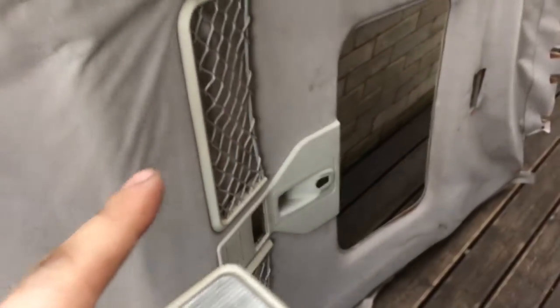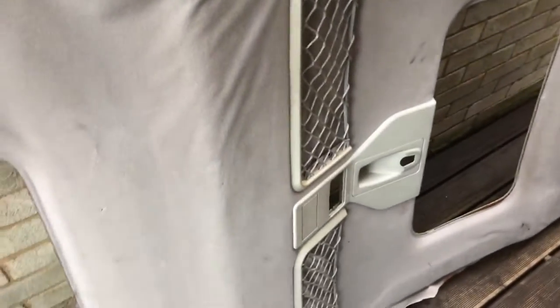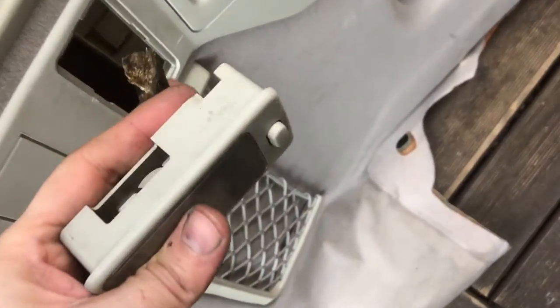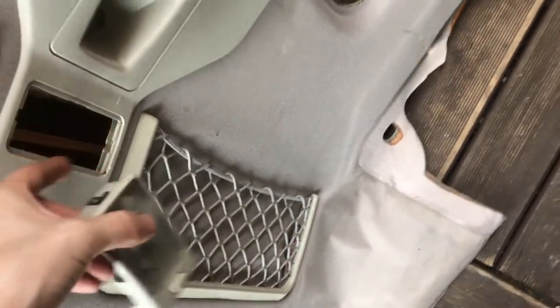The liner's out. I took those things out and put it at an angle — a bit facing towards the bottom — and got it out through the back of the tailgate. You can push it together but that was the easiest way. The light above the rear passenger seats: take this out first to get the clips, because there's a wire that comes down from the ceiling and it's glued with sticky tape. Take this out first, get the wire, and that's what you want to do.